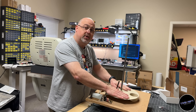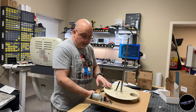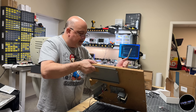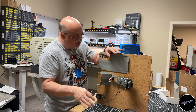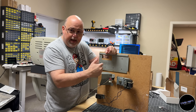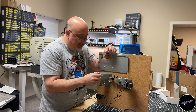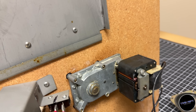The entire mechanism slides into the bottom — this is the tray that spins, grabs eggs, spins them around, and they fall through, triggering a micro switch. That micro switch is for the coin mechanism. There's TTL logic on the board that tells the motor to supply 12 or 5 volts, and a gearbox with a worm drive turns the egg tray until the egg drop switch determines an egg was laid. After checking it out, it became apparent this motor and gearbox are both toast.